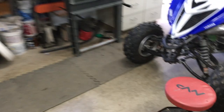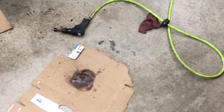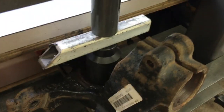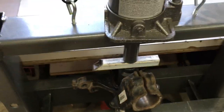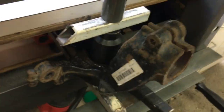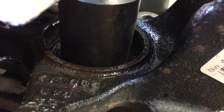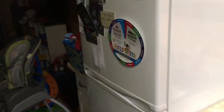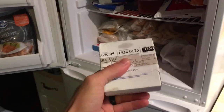Trying to press the bearing out of the knuckle now. I had to use the air hammer with some lubricant back and forth because the press alone wasn't doing it. After alternating between the air hammer and the press a few times, she's finally going — barely, but she's going. MG Motorsports tech tip: freeze your wheel bearings so they fit better. Seriously, it works.